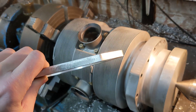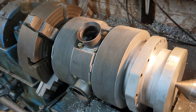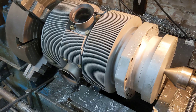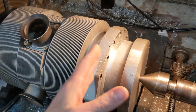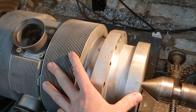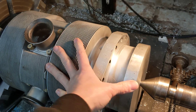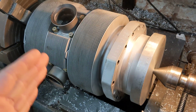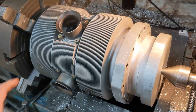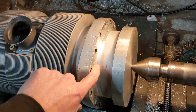So that would have lowered the compression slightly — we weren't too worried about that. But unfortunately, it also on a sleeve valve affects the sleeve timing, because we've lifted the barrel up but the sleeve hasn't been lifted up in the same way. So the opening point of the inlet valve and the closing point of the exhaust valve happened much, much later in the cycle, and the engine just wouldn't have run. So we went back to a standard copper gasket.